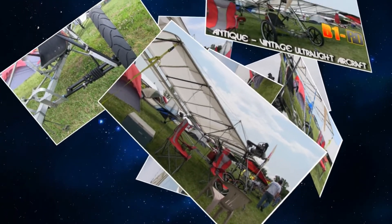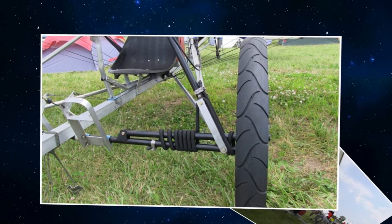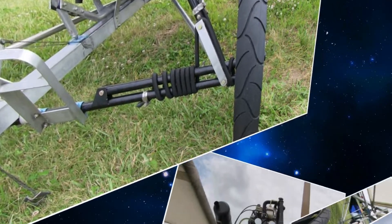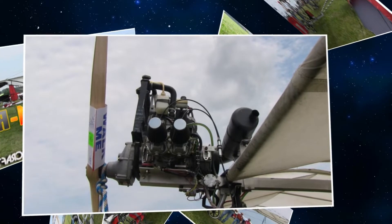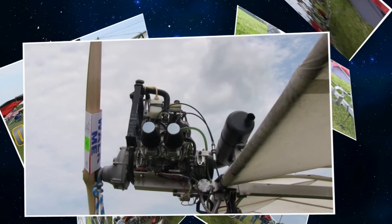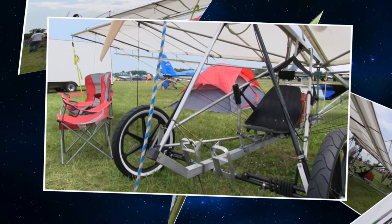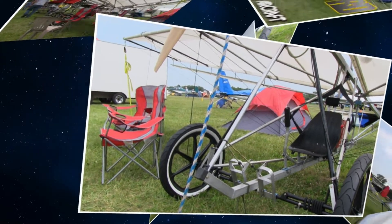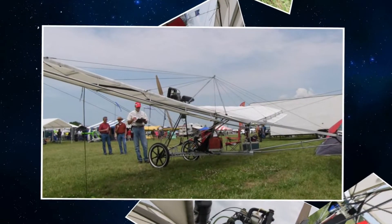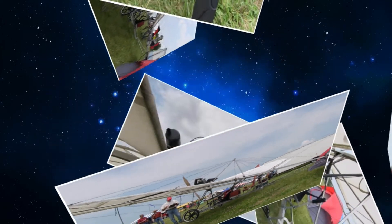When I did rebuild it, I rebuilt it the way I wanted rather than the way it was. It looks like you've used the basic airframe though, although some of it in the back has been changed. Yeah, because the gas tank was originally up on the wing — it was a motorcycle gas tank. I'm opposed to putting that much weight up high, so I wanted to lower the CG. I put the tank down below the CG line on the wing.